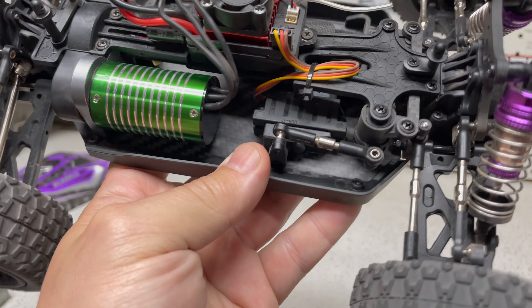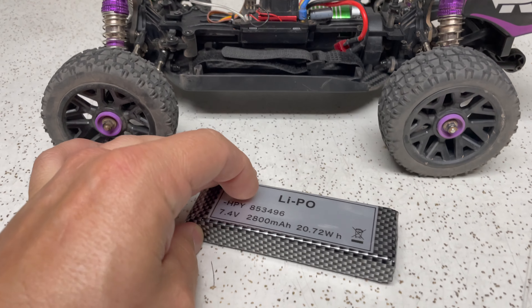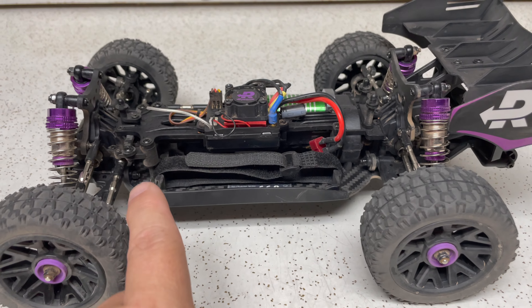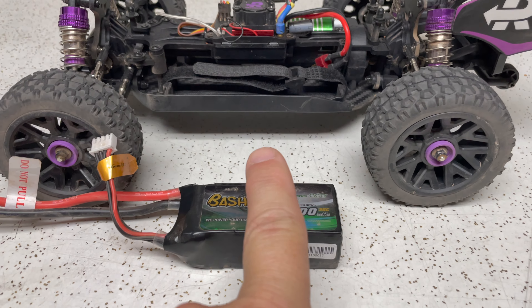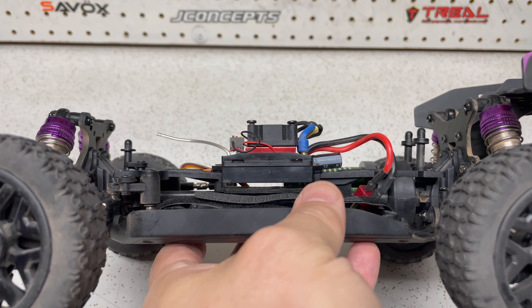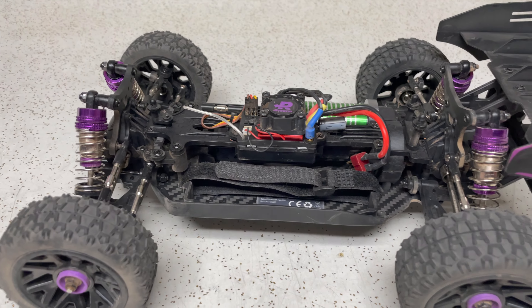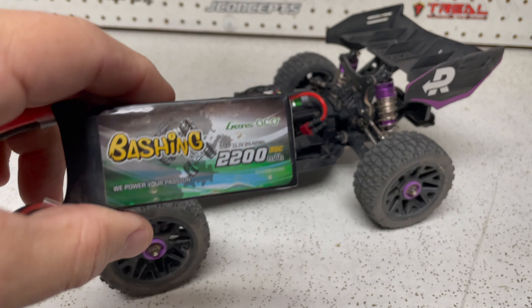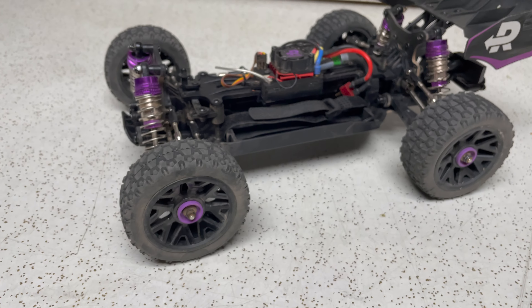Lastly, I'll quickly go over the battery tray. The battery tray is set up for the included 2100 milliamp 2S LiPo — it fits in perfect and the Velcro strap totally holds it. But in the next video you'll see that when I tried to strap in the 3S, it didn't work. There's a lower section underneath the ESC that kept the 3S battery from fitting properly. So I ended up strapping it in a bit awkwardly — it did hold, and I was taking a couple little jumps with no issues — but if you're going to run 3S, just check your battery dimensions.